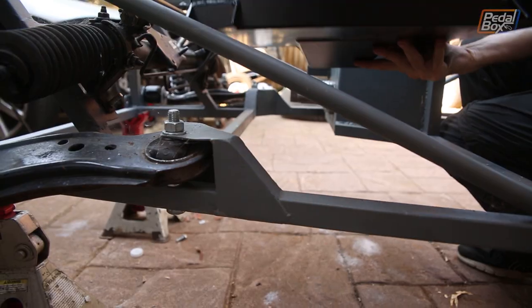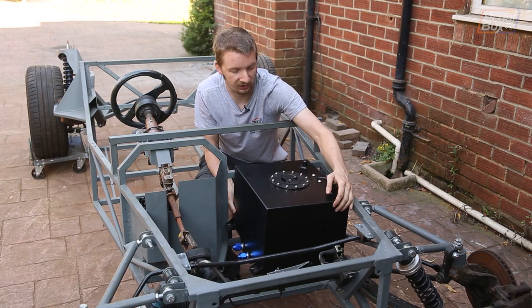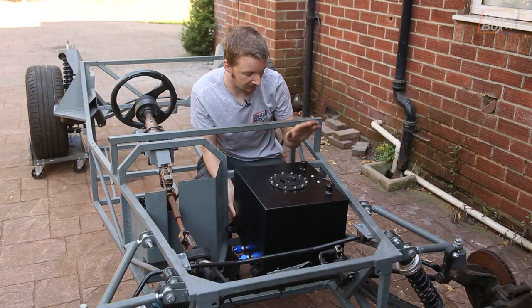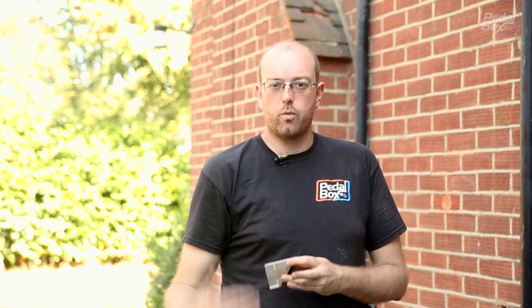The new plan is we're not going to lower it all the way to the floor. We're going to keep it about 50mm raised up and rest the front left corner on the lower trailing arm mount. This gives us about 50mm of clearance underneath, which lines up fairly well with the top of the chassis, and as a bonus it gives us room to run our coolant lines underneath. The brackets themselves are just cut out of some 60 by 30mm box. We're going to notch the bottom so it fits over the front and rear cross members — one where the feet are and one between our rear suspension mounts.